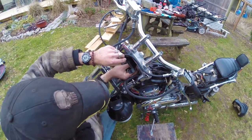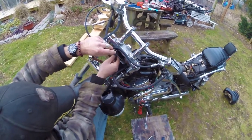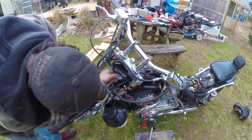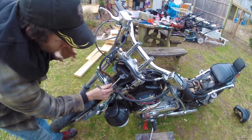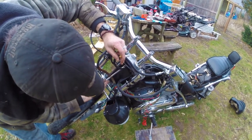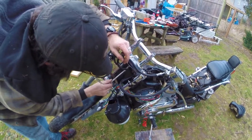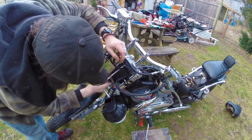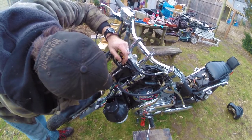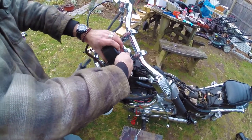It's really cold so you'll have to pardon me if my hands don't work quite properly. Now, if you're doing this on a stock bike and taking off your speedometer cluster for the first time, you'll find they used Phillips head bolts. Due to the angle of everything, when you take them off, get rid of them — use hex heads so you can use a ratchet with a knuckle on it and gain better access, like I'm doing now. The speedometer just goes on with two easy bolts.